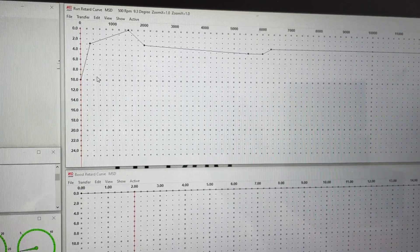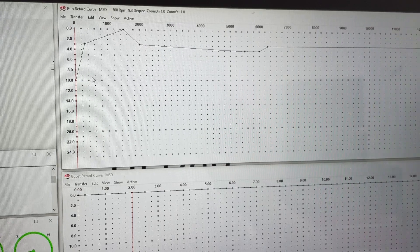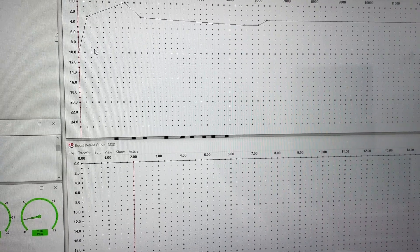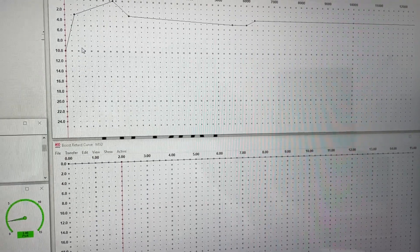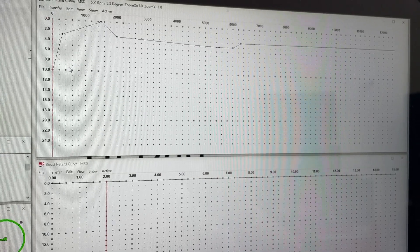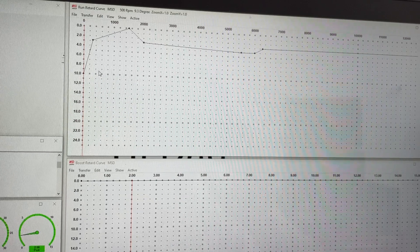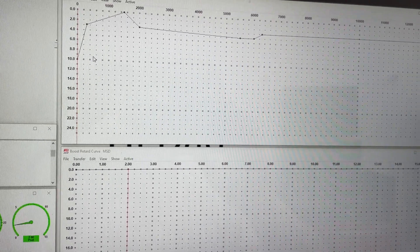The 6AL2 is cheaper than the Grid and it also acts as an ignition box — the MSD Grid is just a timing computer and you still need a separate ignition box. This is both in one, so it's a pretty good deal. Anyway, thanks for watching. I'll do another video about why you should dyno an engine — that's what's on deck. Also, the new engine for this S10 is coming along: heads have come in, I've got some exciting news on that. Coming up I've also got some 18-degree small block Chevy heads, 13-degree small block Chevy heads, Profiler big block Chevy heads, a BMP intake, and some Headhunters Ford heads — so a lot in store.